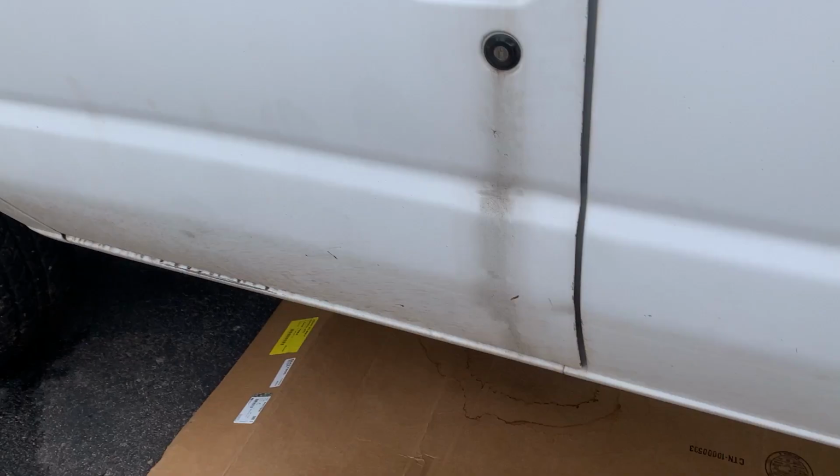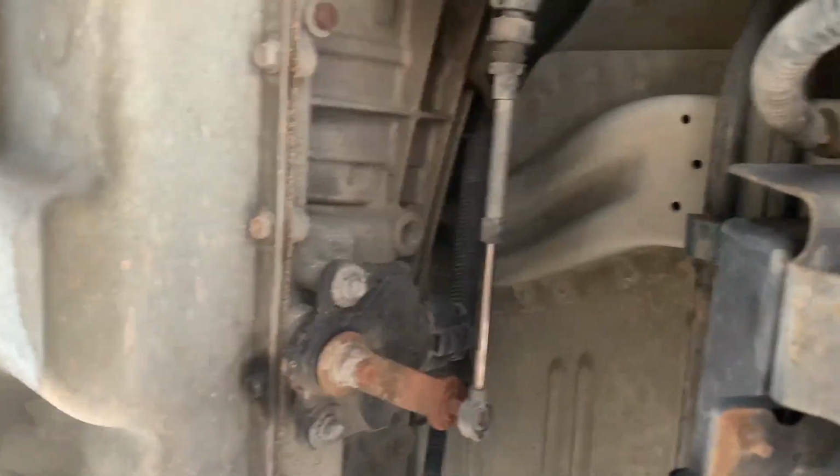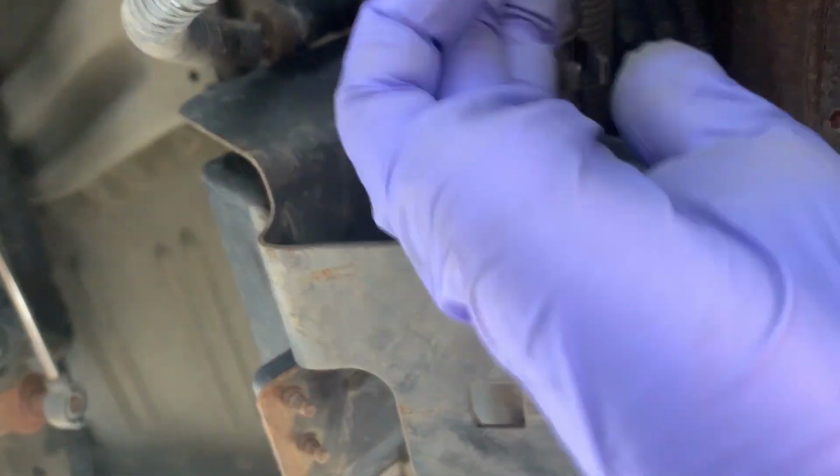We're on the left side of the E350 van, around where the driver door is. We'll just slide under here, and this is the fuel filter right here, and I actually just broke this by moving it around. It appears to be just held on by a zip tie. There we go. There's probably a better way to clamp that on there. Anyways, the fuel tank is back there, and it pumps the fuel this way past the filter into the engine. So we're going to want to get the fuel out of this side so it's nice and filtered and we can use it in something else.